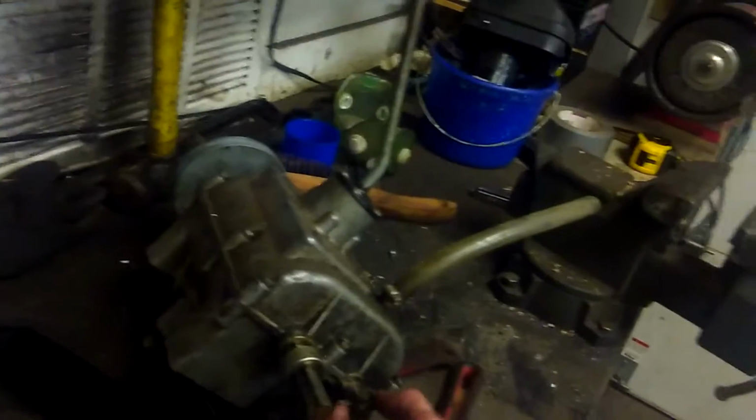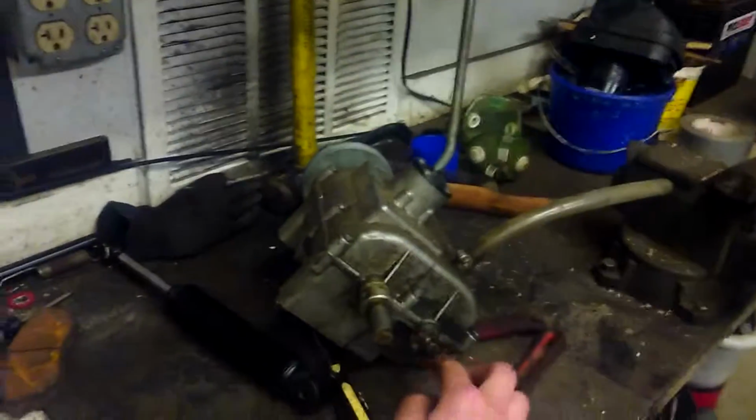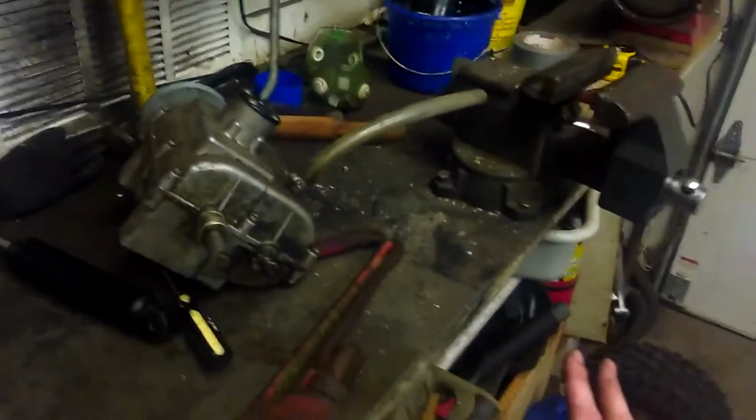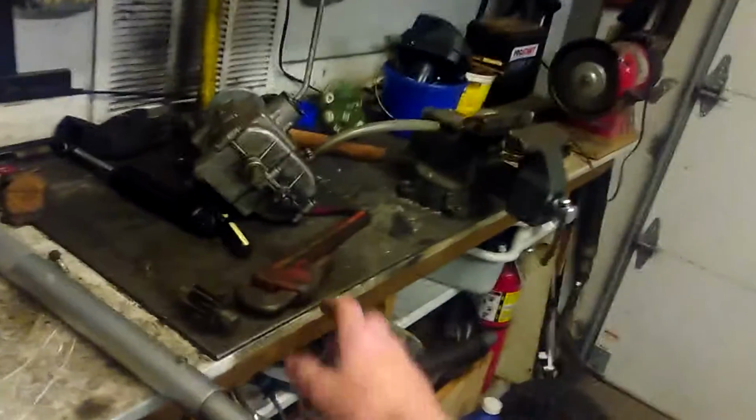as it is, it's 1.3 to 1 in first gear, 1 to 1 in second, and then it's like 0.6 to 1 in third gear, so it's a little faster. So if you run this, this is 40 chain, so it'd be like a 50 tooth. I'd say like a 54 tooth to 8, be a 6 to 1, something like that. That's an 8 tooth sprocket, a 7 tooth sprocket. So you do the math, 7 times 6. It'd be perfect. It'd rev out each gear.